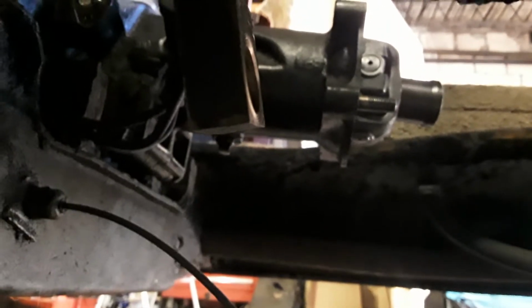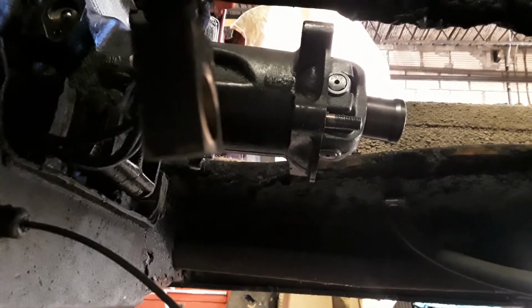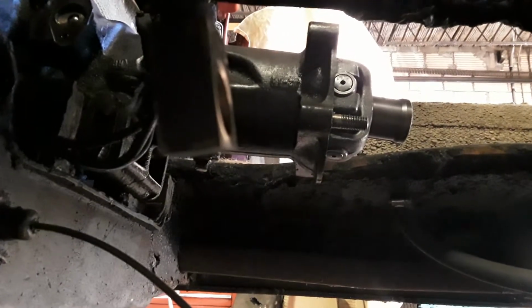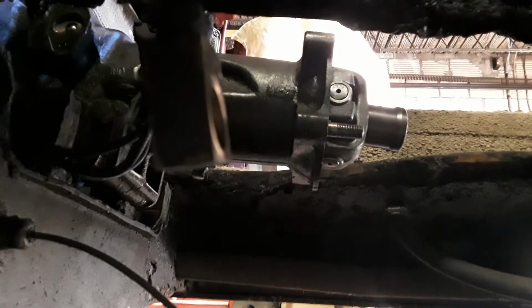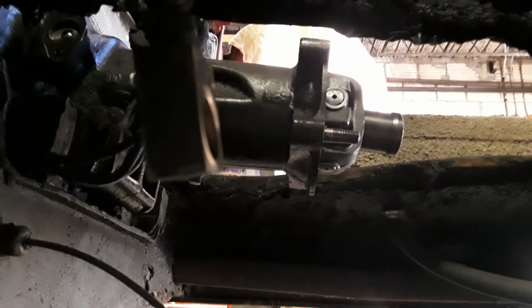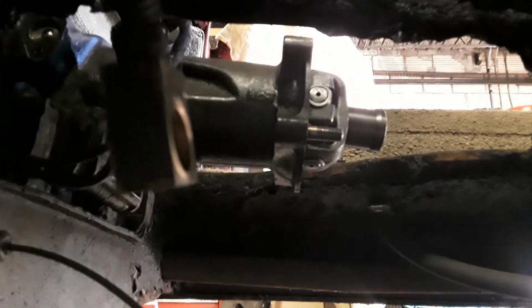The only difference is about 90 thousandths of an inch, and 90 thousandths may not sound like much, but it is enough to possibly cause bind. So if we at least do good practice to get it centric where it was, it should perform just fine otherwise. That's the only thing different I could really see on it. Everything else will line right up, everything will slide right together. I've already test fitted it on both ends, so that should work out pretty good.